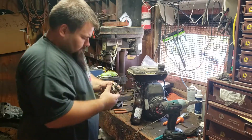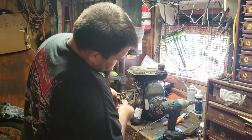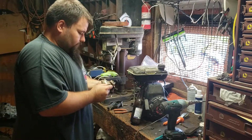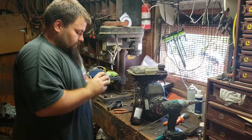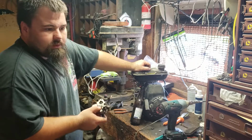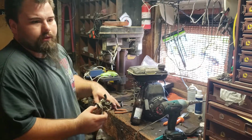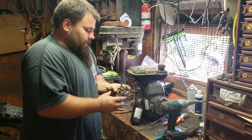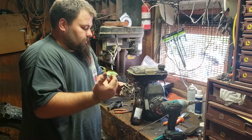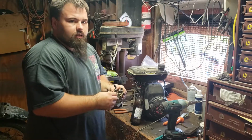So, carburetor. You know, the thing about these, about the Monovox, I think that's how you say it. A lot of people had issues with the carburetors. And what I found more effective than anything else is that, like I could see it right here, there's a little clog, but put some salt with hot water in a big bucket. Hot water, like almost boiling hot. Take everything apart, sit this in there, wait like an hour or two until the water gets kind of cool. Take it out, do it again with no salt, put it back in there, rinse it out, and I guarantee that there will be stuff in the bucket on the bottom.